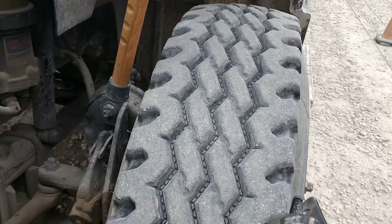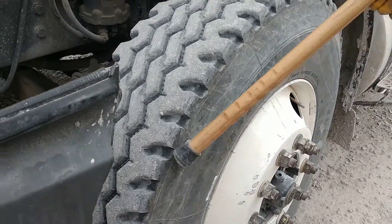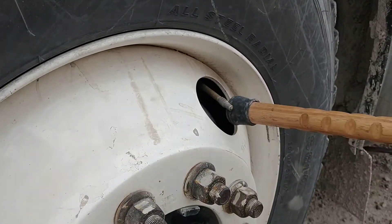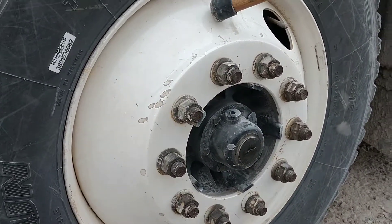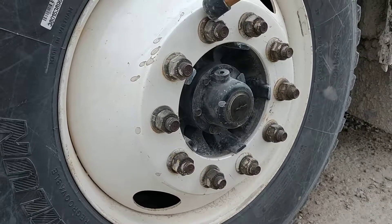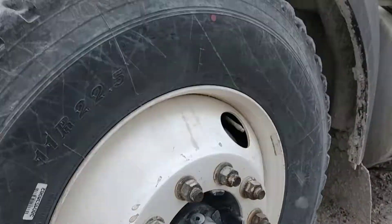Now I'll do my tire. All three sides of my tire — no abrasions, bulges, or cuts, no audible air leaks. I'm going to check the tread to see that it's evenly worn. The steered tire has a minimum thickness of four thirty-seconds of an inch. I'll check the tire tread depth gauge and make sure there are no loose or separating treads. The sidewall reminds me to check inflation to manufacturer specs; I'll check at my valve stem, which is properly mounted and secure, not missing the nut, not cracked or broken, no audible air leaks, and the cap is in place. I'm going to check my rim — properly mounted and secure, not missing any nuts or bolts, not cracked or broken, with only manufacturer-made holes or welds. The lug nuts are properly mounted and secure, not cracked, broken, or missing; I'm looking for looseness or cross-threading — silver threads or rust streaks on steel, powder streaks on aluminum. Hub oiler — properly mounted and secure, not missing any nuts or bolts, not cracked or broken, not leaking, filled to the proper level with the cap on securely. And that completes the engine compartment inspection.